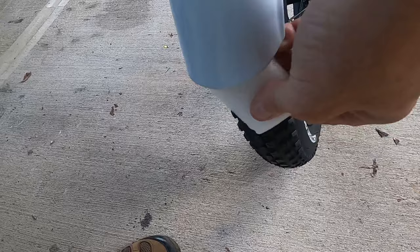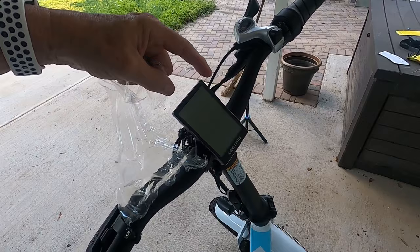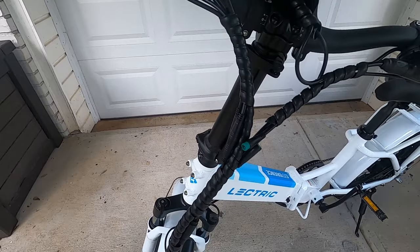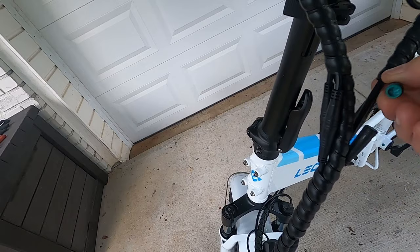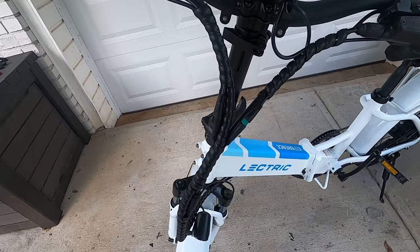When I put Kay's bike together earlier, I noticed there are foam inserts between the tire and the fender — make sure you get those out, and there's one in the back as well. Remove the plastic covering here — there's another piece of plastic I'm going to leave on for a little bit just to protect things, same with the shifter. I notice some connections I need to hook up. They have little flanges so they only go one way — be careful, there are really thin connectors in there, so don't force them. Make sure they glide in slowly so you don't break anything.